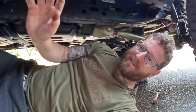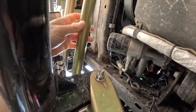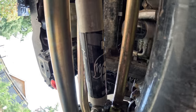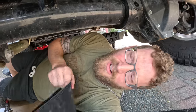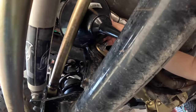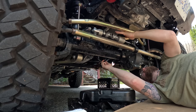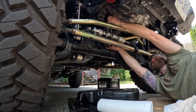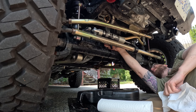All right, trying to get out from underneath here. Now I have to get to the oil filter, which sits right above our axle drag link steering stabilizer. I feel like it's gonna let some oil out when I loosen it off. It's already starting to turn, so I know this won't be a hard oil filter to get off — I just have to figure out how I'm gonna catch the oil. I've got a funnel here to try to direct any oil down to a catch pan below. Got it — just oil on the axle housing, which is gonna be much easier to clean up.